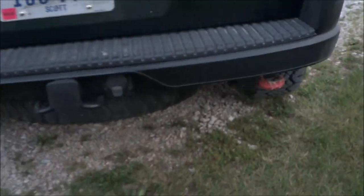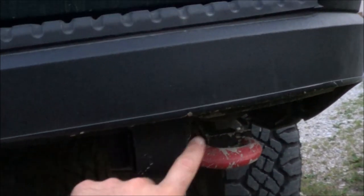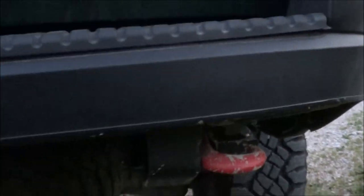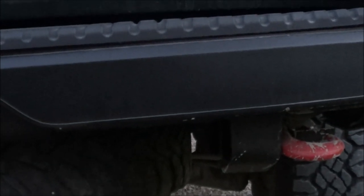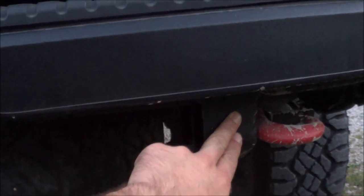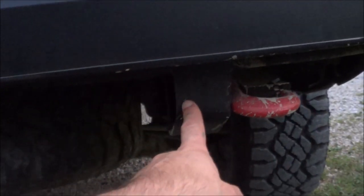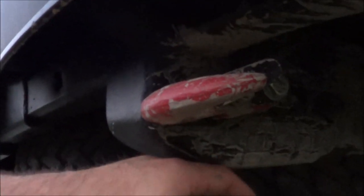These mounts had some kind of goofy metal on them from the factory — from being transported and molded and mounted. So I sliced those off, capped it off to make it flush, and then got some steel that I trimmed and welded at the top, then just kind of heated up, clamped, and bent around. So it's kind of like a frame rail skid guard that'll protect anything — protect the plastic if I hit the ground.